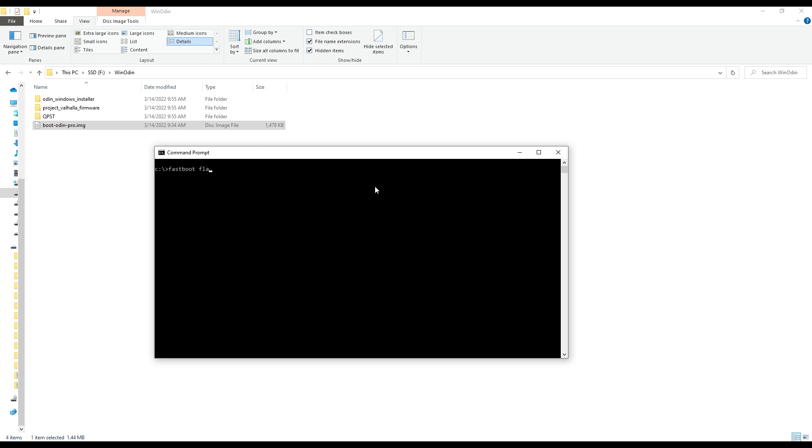Now, you will need to flash your bootloader. Hold down the power button for 10 seconds and your device will be in fastboot mode. You need the ADB drivers for this part, which are linked on GitHub. We are going to flash the boot partition with the file that we downloaded earlier and then we are going to restart the device with fastboot reboot.